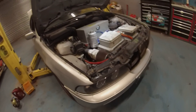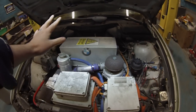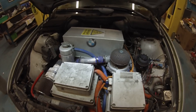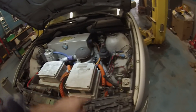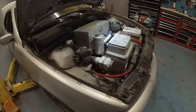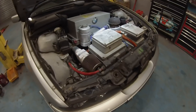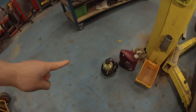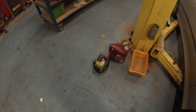Pretty much all of our DC systems have to come out: the controller, which has worked perfectly — one of my variants of the Paul Holmes design — the blowers, the charger, and we're also putting a new power steering pump in. It currently has the Toyota MR2 pump, which can't keep up with the BMW power steering rack when you're doing fast steering. We're changing to the Opel Zafira electric pump, which I've used several times including in the E31.